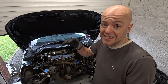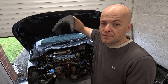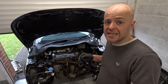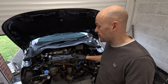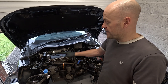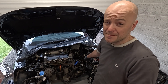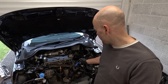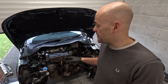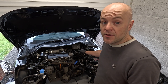Now it is a bit awkward to get the engine in — you've got to lift it up and over the subframe and then backwards. But once you've done that, the tip I would give anyone doing it is put the bottom mount in first, which is unusual. Put the bottom mount in first, then you've got your cam belt side mount, and then obviously the gearbox mount — because that gearbox mount is a pain because of the way it sits on the chassis rail lip. If you're doing it you'll know what I mean. But yeah, it is all original mounts.